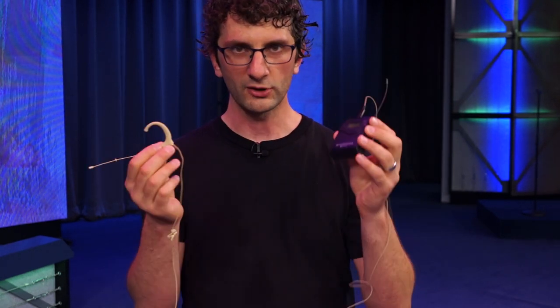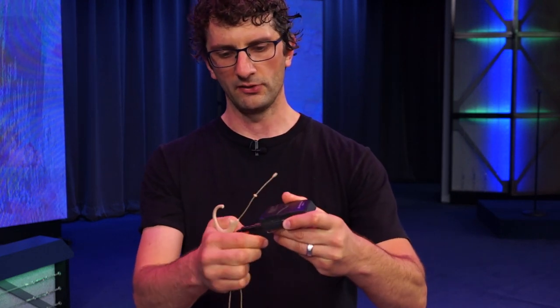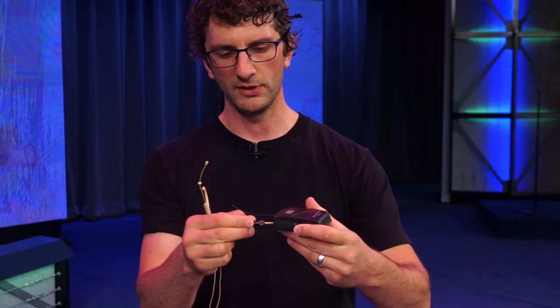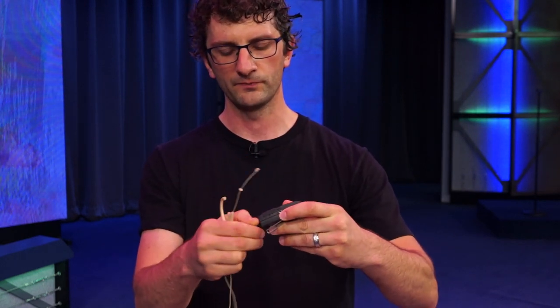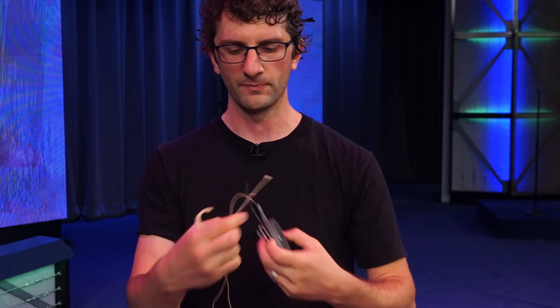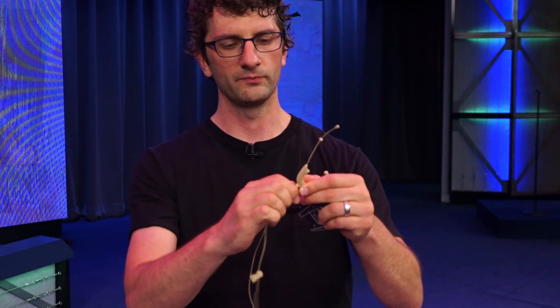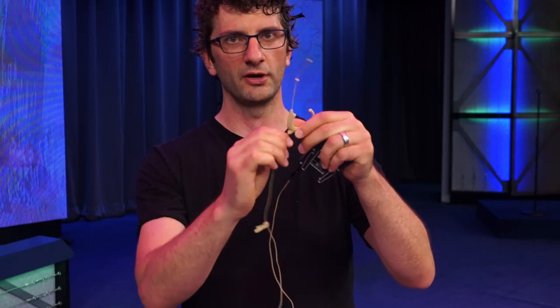So first of all, what I'd say is when you have a pastor preaching, long before they get there — during your sound check or during your rehearsal — take your pack, take your mic, plug them in together. These screw in here, pop them out, they pop in like a headphone and then screw down. First thing I would do is make sure that's good and tight and properly connected, then go back to the mic itself — this is a screw-on as well — and just make sure that's screwed on good and tight.